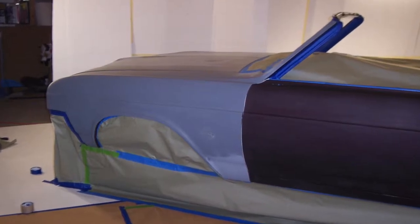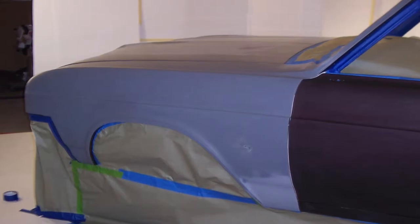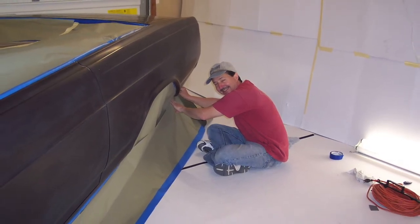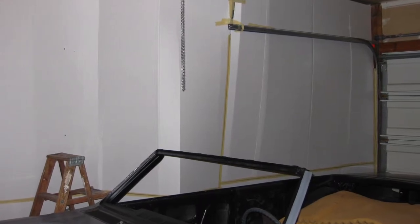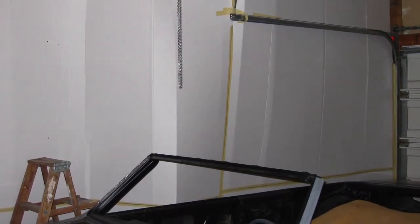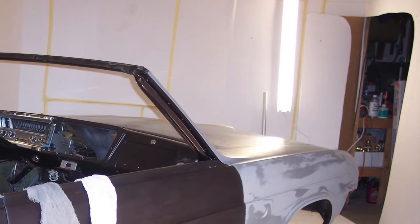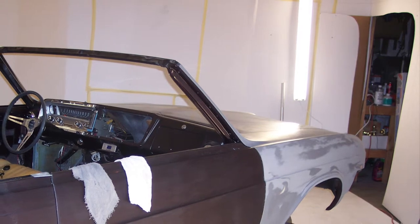I just needed to sand and finish everything on the front end, go back over all the painted surface, sand and smooth all of that, and it was ready for paint again. For this round of paint, I wanted to make sure I wasn't going to get any dust or lighting issues. So I covered all the floor and walls of my garage with white cardboard. I cut a doorway — it's a three-car garage — put the car on the two-car side at an angle, and set up the third-car side with a paper doorway, where I had my air compressor with filters and fans.